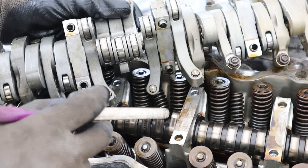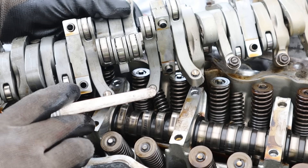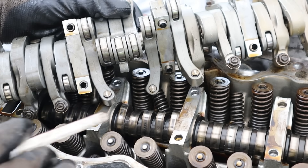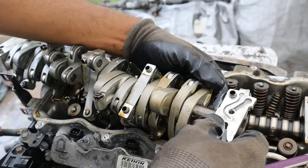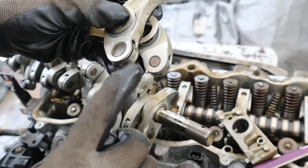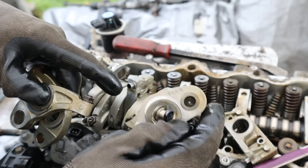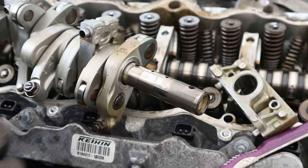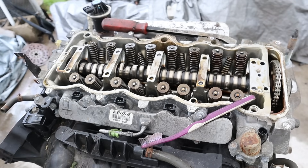Performance versions of VTEC would have normal cam profiles on both sides, allowing air to pass through an even higher cam profile on the middle set so you can add even more air at extremely high RPM. The VTEC is actuated by putting oil in through the end pipe where it goes down and that little plunger locks into the adjacent arm in this pocket so they can rock together. Here you can see the holes for lubrication and for the activation of the VTEC system.